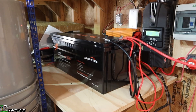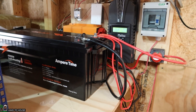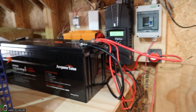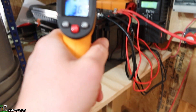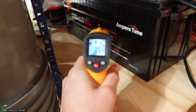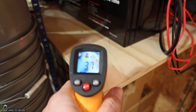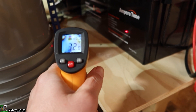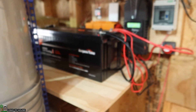Let's go ahead and charge this battery up full and then do a full discharge when the weather is a bit warmer. Just after I finished mentioning the previous temperatures, I noticed the battery kicked over to 14.6 volts. Using my temperature gun, I'm getting 36 to 38 degrees on the battery now. Down lower it's around 31 to 32 degrees. So the battery has warmed up more than the other surfaces — it is certainly warmer inside there than it is out here.